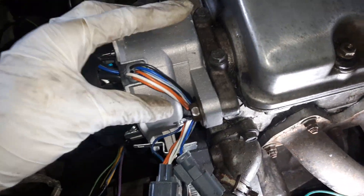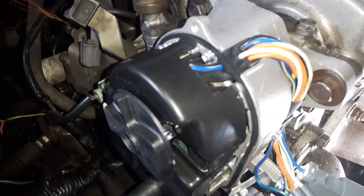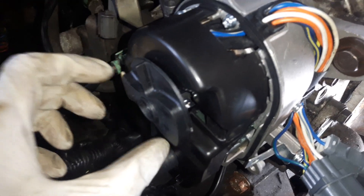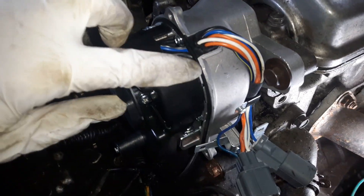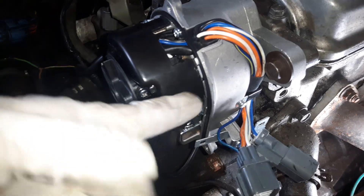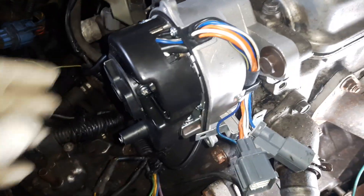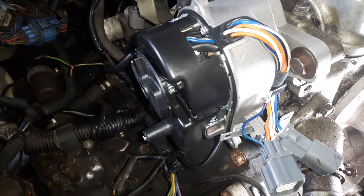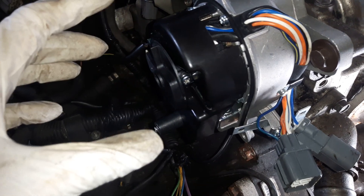Push the dizzy in and put the three hold-down bolts — one, two, and three at the bottom. It's not going to be exactly aligned to number one because the timing isn't exactly at the top of the piston, but it should be good enough. One thing to watch: the gasket comes off very easily and can get crushed under the cap, so make sure it's seated nicely. Put the cap back on and the spark plugs back on. It's always ideal to use a permanent marker and write number one, two, three, four on the cap just to make sure you don't mix up the wires — otherwise it will not start.